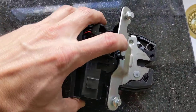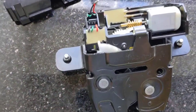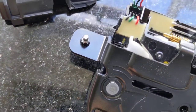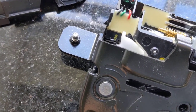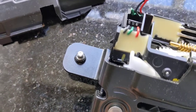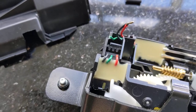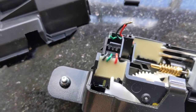If you remove this from the car — there are lots of videos on how to do that — the problem is this little micro switch just inside the unit has failed. I've tried various fixes, I've tried packing it, but the micro switch is gone. So what I decided to do was cut the wires, and I found out that if you connect the black and the red together, that overrides the signal so the car thinks the boot is shut all the time.